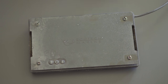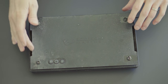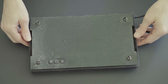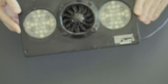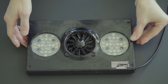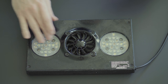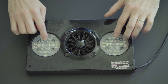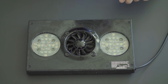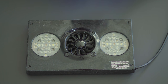This is the Radion that you saw above the tank. I've taken it down and you can see it's quite dirty. There's a lot of salt spray — this is where the return came in — and just lots of salt and dust on the top. The bottom where the light faces the tank also has some salt spray on the fan. I do wipe down the LED lenses so they're relatively clean using lens cleaner. To get in and actually clean the fan off, I think we're going to have to take these four screws out, and maybe these four too.